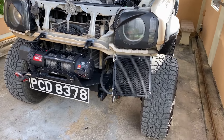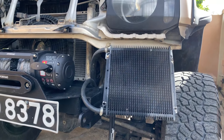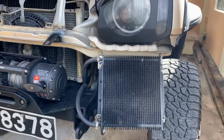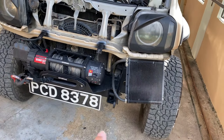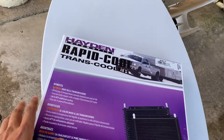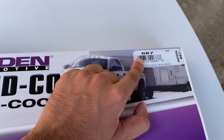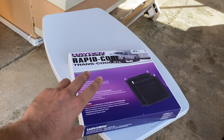Here's what we're working with. This is the transmission cooler — it's a Hayden 679 transmission cooler, which is 11 inches. To fix our problem, I'll be replacing that with a new transmission cooler, which is the Hayden 687. It's slightly smaller at seven and a half inches.